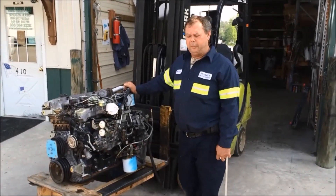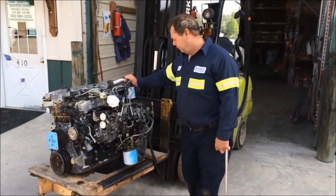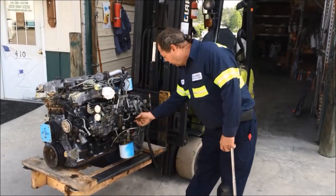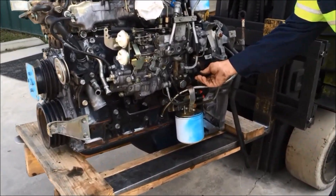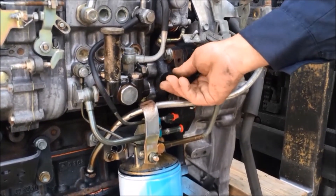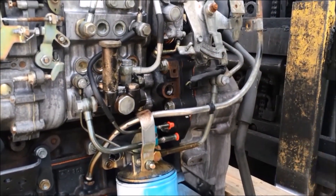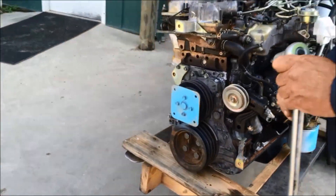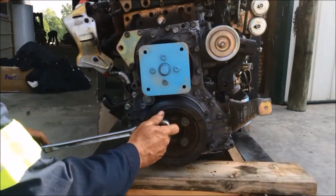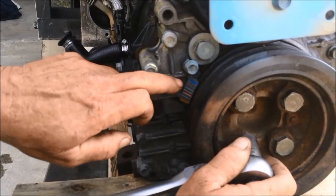This is the simplest way I know to uninstall and install the injection pump on a 4-HE-1. The first thing to do is remove the timing and inspection bolt, which is in the side of the pump. You remove it and then come around. You'll find a mark on the closest groove here, near the timing marks on the front cover.